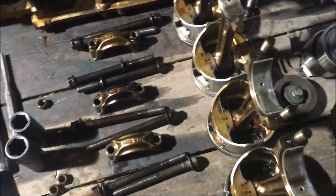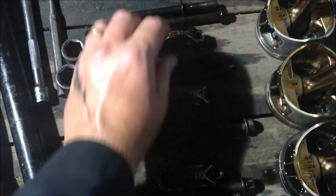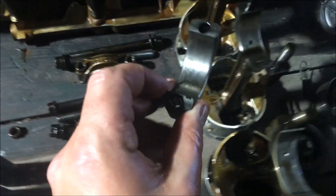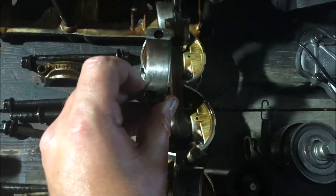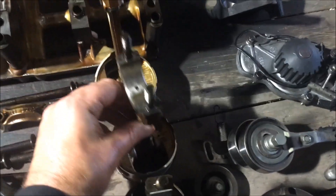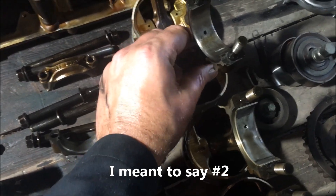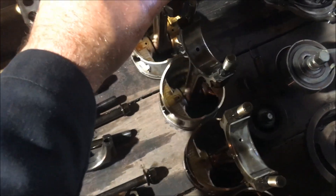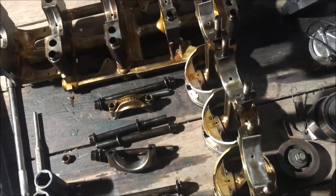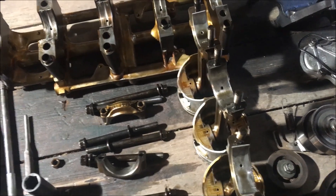Also the caps — here's the cap for number three, rod bearing in there. Cap for number two — no rod bearing. When I opened this up, the rod bearings were completely missing. Also, the wrist pin is loose. The other ones stay up nice, but number one is extremely loose. Hitting and knocking around without rod bearings in place, because they had obviously been spun and shredded into the oil pan, caused the wrist pin to be under load and it loosened that too.